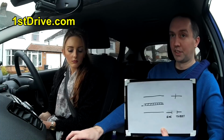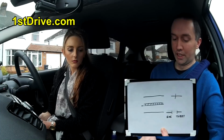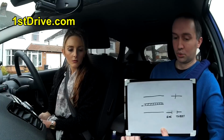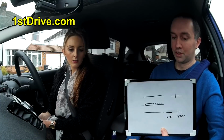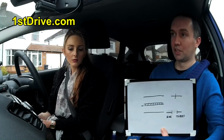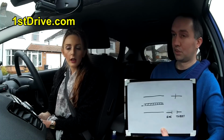You move into first gear, and then we're going to lift the clutch just a little bit, and you'll feel it when it gets to about that point there. You'll feel the car. If you're doing no clutch for now, because when I do mine, yours will feel a bit funny. If I lift mine about halfway, roughly about there, you feel the car pull. It sounds a little bit different like that. It kind of makes that growling sound. And if you listen to when I put it down, it kind of lifts. It sounds a bit different.